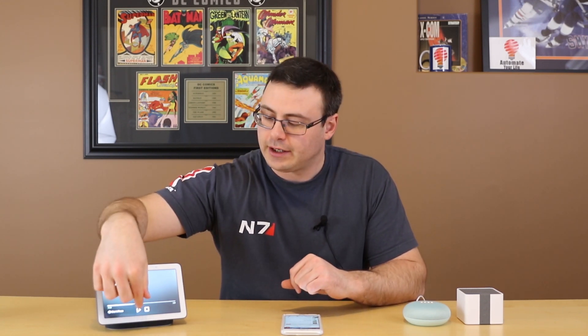If I had media streaming as I made the Bluetooth connection, that play button would have essentially started right away. But because I didn't, this play button here on the Google Home Hub — because it's a visual device — gives you the ability to play and pause. I had to hit that and then my music started playing. On non-display devices, as long as media is playing it will just start, because there's no way to physically interact with those devices to start and stop.